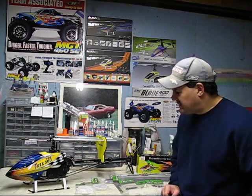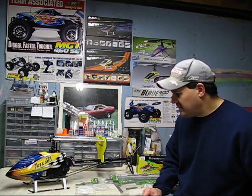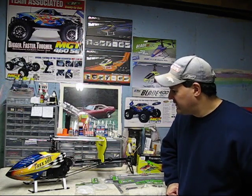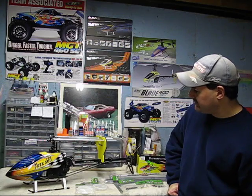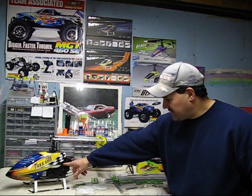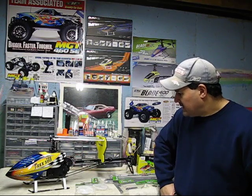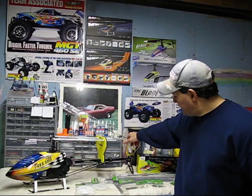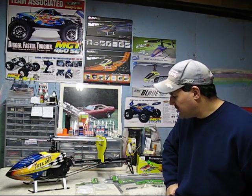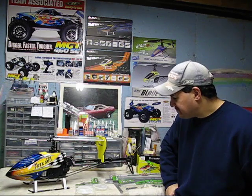The one thing I didn't mention, because I didn't pick one up yet, I haven't flown this machine, so I'm just slowly gathering spare parts over the winter time for the spring to have in my field box. But definitely front torque tubes, the gear set, okay, in there, because any contact usually with these blades hitting the ground, and those will strip out on you. They'll break teeth. So have a couple of them on hand. They come in a pack of 2 and a pack of 1.